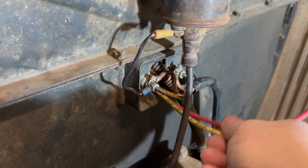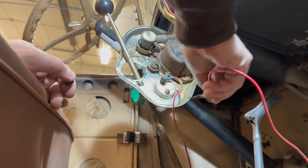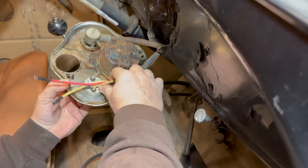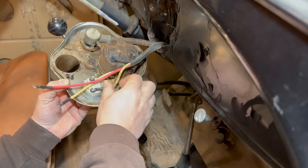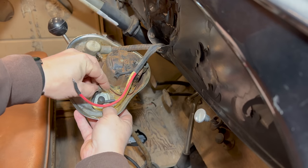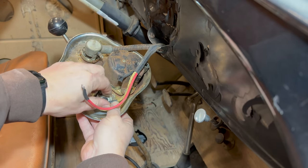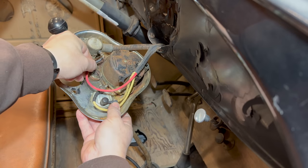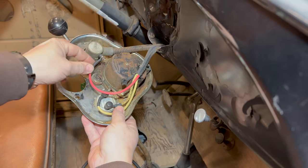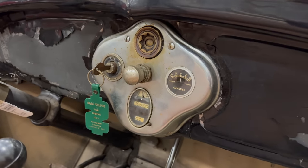On the engine bay side we can see three of them right here. First I'll get this old wiring out — this is the one with everything melted together. I'm going to curve the wiring around the speedometer, yellow and black here. The yellow wire will be right here, and then the red wire comes over to this terminal here. With the wires connected I reconnected the speedometer cable and fastened everything back to the dashboard.